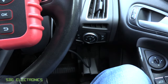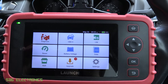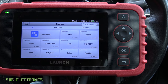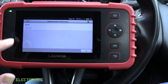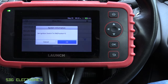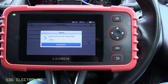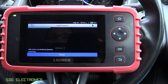We're hooked up to the car's OBD2 port. This vehicle does have the engine management light on — it's a Ford Focus with the little one-litre three-cylinder EcoBoost engine. Let's see if we can find what's wrong with it. We click on Diagnose, and you can see we can either do auto detect or pick the vehicle brand directly. Auto detect is a little bit slower because it has to work out the communication protocol, so it's quicker to go directly to Ford. We press OK and it will work out what vehicle is connected — and we've got Ford Focus 2017, which is correct.